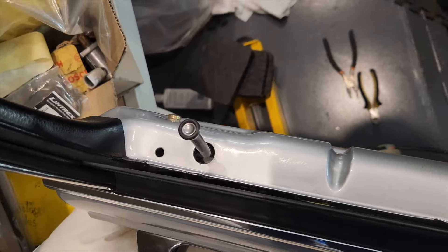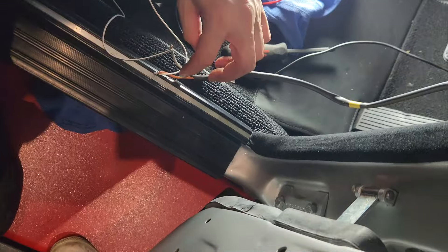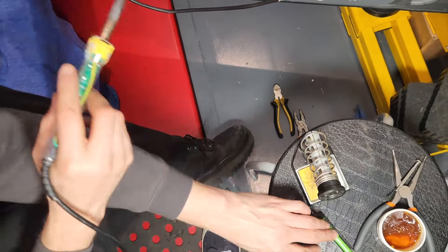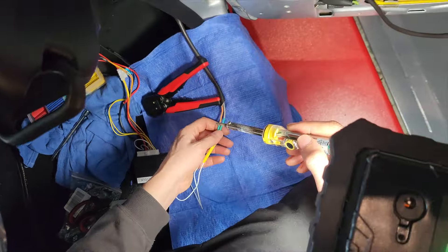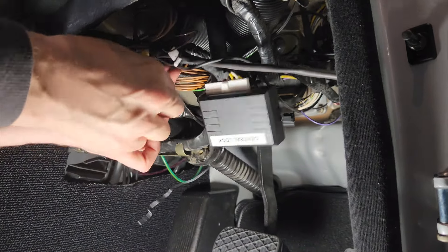You can now see the remote is actually working - great. It just needs to be tidied up. We've checked the polarity and it's working well. This is a lot less wiring than you'd actually think. Just a bit of flux, soldered, and heat shrunk together, then heat shrunk again over the top to keep it all tidy. A really nice job compared to what you'd get at a stereo shop. Just securing it under the dash - I hadn't got around to putting my kick panels on yet, so this was one of the last things needed under there.